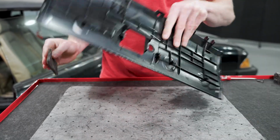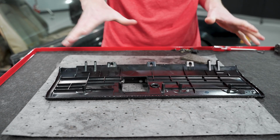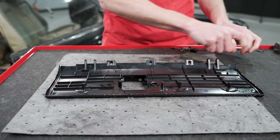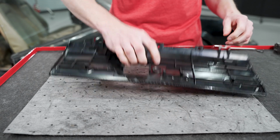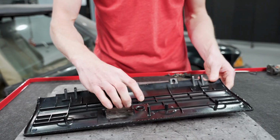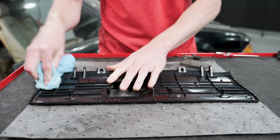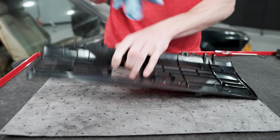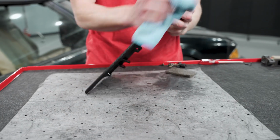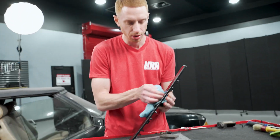If you wanted to just lightly hit the backside, you can. But for what we're gonna do, we're gonna cut the part in. Basically, we'll start on the backside. We're gonna spray the edges first, and then we'll flip it over, and then we'll spray the face of this. If you're one of those people that feels like you gotta paint the whole panel, by all means, you can paint the whole panel, front and back. It's just you won't see the back once it's installed onto the vehicle.